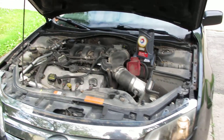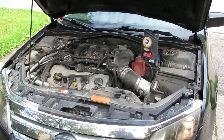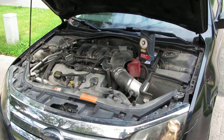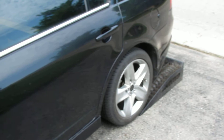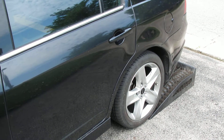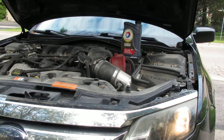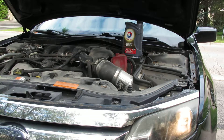Hey guys and girls, this is a follow-up video to that transmission cooler line fix I did. After you do that fix, you obviously want to make sure the fluid is replenished, since I did lose some fluid. You have to have the vehicle in neutral — it's running and in neutral right now. Make sure you use the correct fluid; this is a Fusion Sport, so it uses an Aisin transmission, which is a Japanese spec, so it uses a special fluid. We're going to check the fluid right now.